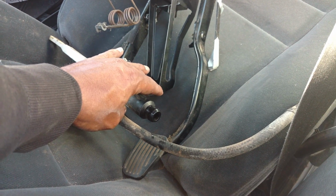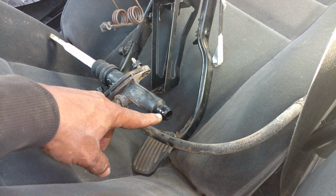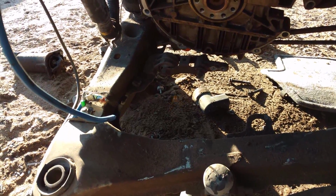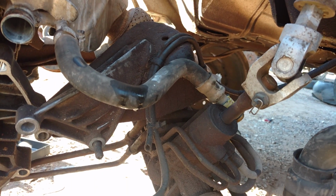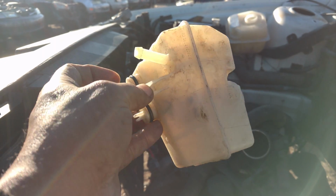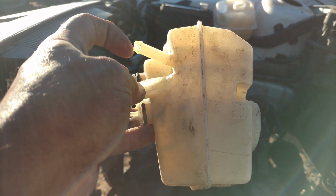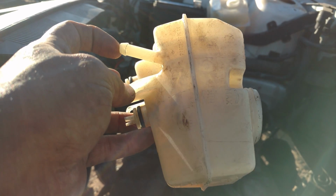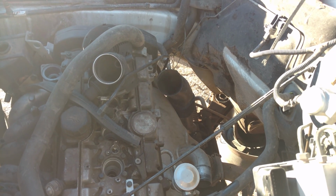On most of these cars, especially the ones prior to 98, they all have an external slave cylinder on the exterior of the transmission, and you want to get the line that plugs into here and goes to that. If the car has new or very good condition mounts, you want to get that transmission torque mount there. You want to take this mount and bracket off of here. You want to consider getting this or get one new. The automatic vehicles have this extension on here for that clutch slave, but the tip of it is capped off. You may be able to cut that off, clamp that hose on there, or you'll need to get one of these, preferably new.